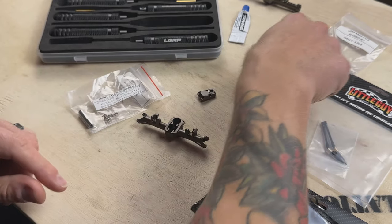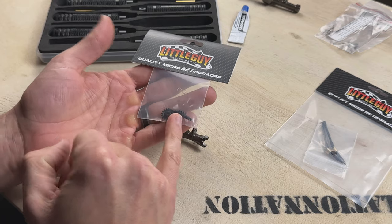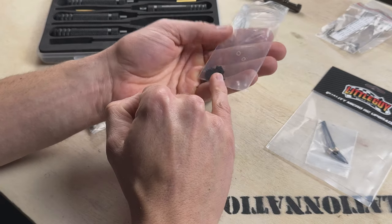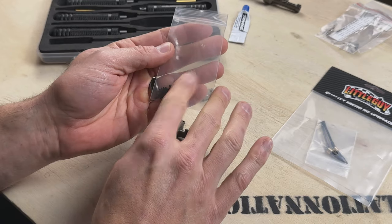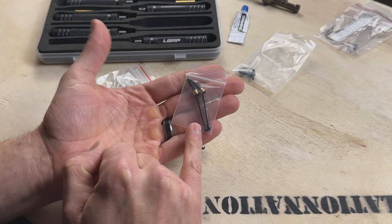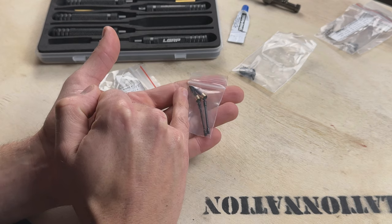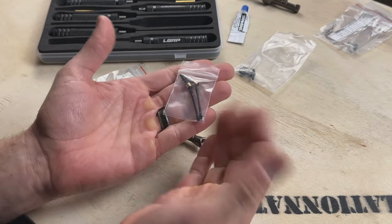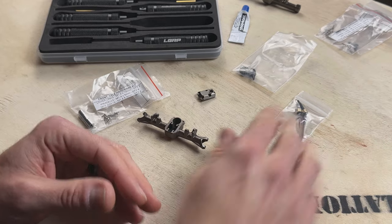As long as you are not overdriving the front, the front and rear sizes of the worm gear and worm screws will be exactly the same. I'm not going to dump the contents of the gears out just yet, because there are a couple of very small O-rings in here that I don't want to lose. With the axle shafts, the same thing — I'm not going to dump these out because if the collar pops off, the pin that holds the CVDs together can slide out and the axle can come apart. So keep everything contained before installing them into the housing.